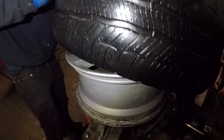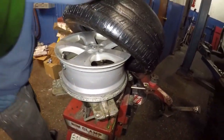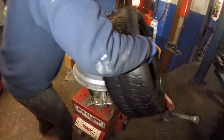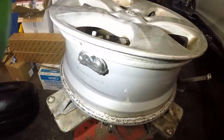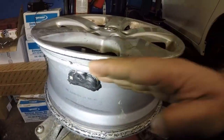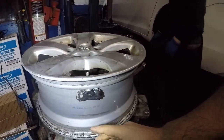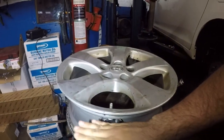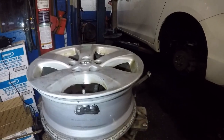We never touched that sensor. Now we'll mount a new tire and show you how to mount it without breaking the sensor. The reason we want to stay away from it is because if you hit this while breaking the bead, it's gonna smack that sensor off. If you dismount the tire from that side starting from there, the tire's gonna go in and hit it — and that's how you break your sensor.